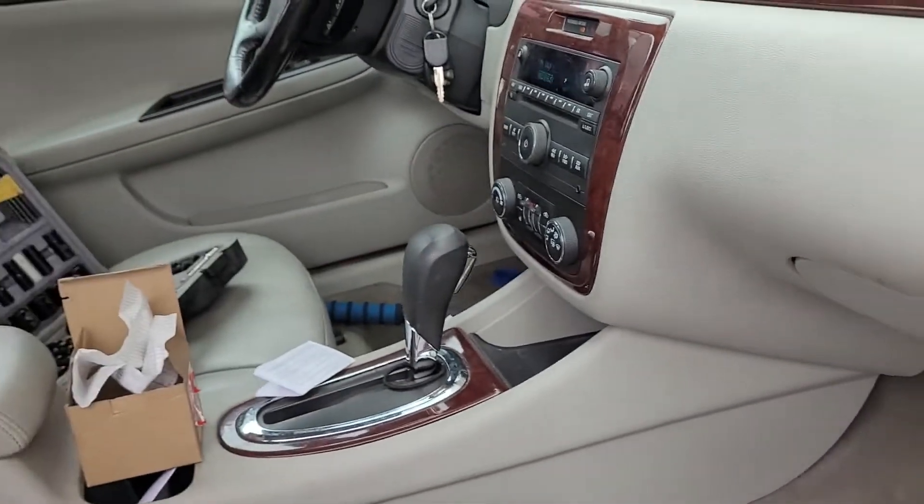Again, ready for all the heat and air conditioning all summer and winter long. There you go — in a couple of minutes, in the snow, in the flurry, in the cold, we're able to knock out the blend door actuator removal and replacement on this vehicle. Again, there are two of them. If you're working on your own Chevy Impala and you hear that clicking noise, try to use your ears and your hands to feel around the radio and glove box to find where the clicking is coming from — one on the driver's side to the left of the radio, and one on the passenger side behind the glove box. Same process, same size bolts, same wiring harness, same part. Easy job to do at home. If you have any comments or questions, drop those below. Please like and subscribe, and as always, take a minute out of your day to do some maintenance. We'll catch you next time.